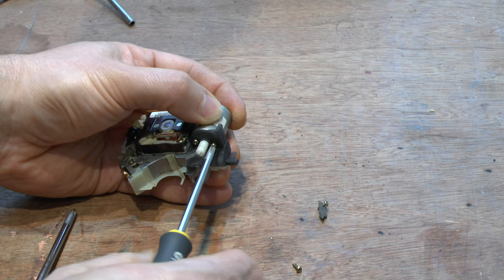Taking care not to touch the lens. I noticed on the 919s I've had in the past, the letter D was written on them — I'm just wondering if that's to indicate the DVD different type of laser. I managed to get that one to actually read a laser disc but only once. I've put a little bit of grease on. I'm going to have a look at the assembly — put it in with the little groove that way, that's the way I've seen most of them coming out. Pull it in here, give it a little wiggle and twist it to get enough grease on, and that will be more than enough to keep it lubricated. It's lithium grease you're using.